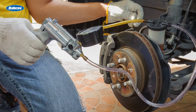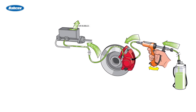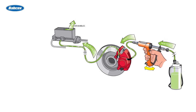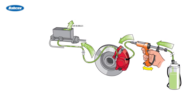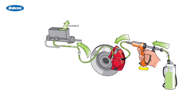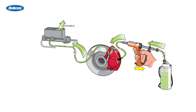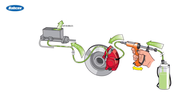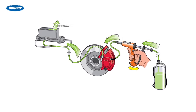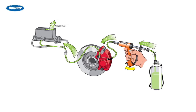The drawback is the equipment can be expensive. A pressure bleeder utilizes an adapter that attaches to the master cylinder, then forces fluid into and through the system. The main advantage to pressure bleeding is that it's quick, but sometimes it's also necessary. This is especially true on some newer vehicles with anti-lock braking systems. Air can get trapped in the ABS valving, and in some situations pressure bleeding is the only method that will work. The high pressure compresses the air bubbles to the point where they're carried through with the fluid instead of hanging up in a crevice while the fluid flows by.